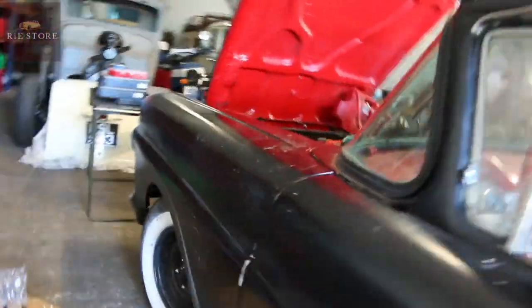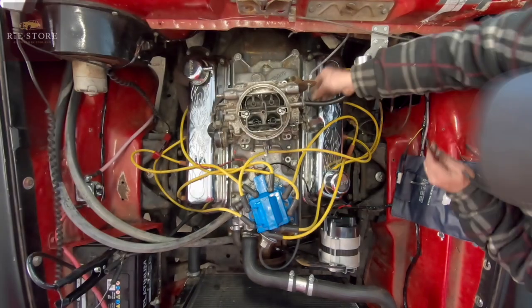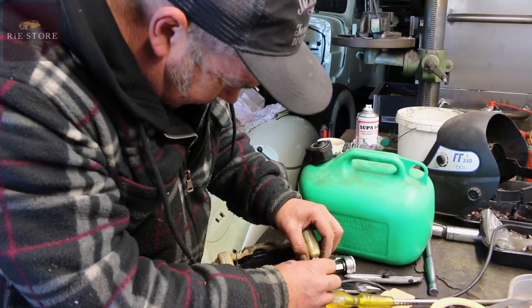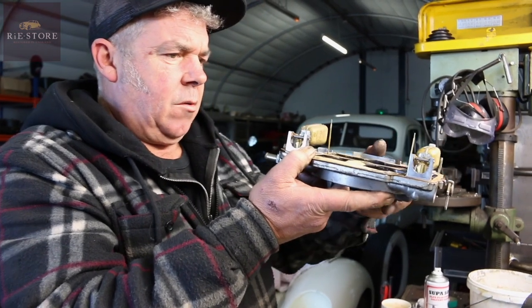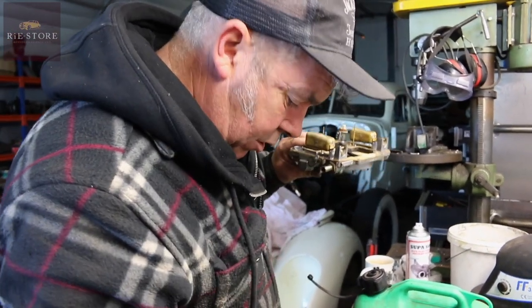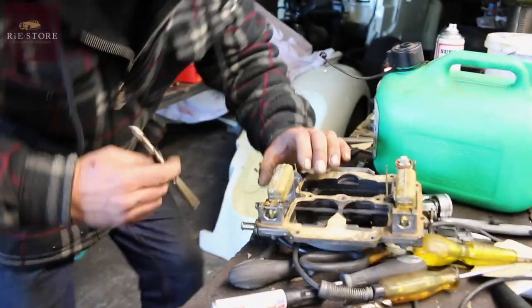OK, turn it off. I'll take the fuel to there so it's in the carb. That topped the carb off again. Well, I don't know why those float levels were like that. They should be 7/16th of an inch from what I've read, which is 11mm - and one of them is near enough. That one's a bit low. I'll come down a little bit actually - I'll go to 10mm, because we weren't getting enough fuel in there.